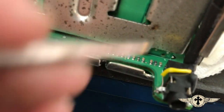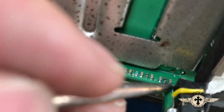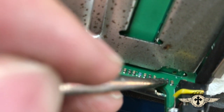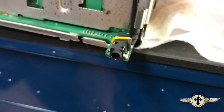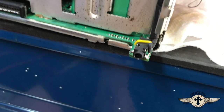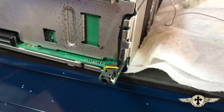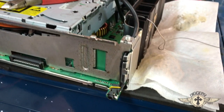Now we have to remove this block — you have to cut the circuits going to these blocks. I'm choosing to remove this one block, which is your sense line. It tells the stereo when something is plugged into your aux port, so by removing it you're telling the stereo that something is always plugged into your aux port. After we get done with that, we'll put the stereo back together.